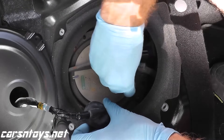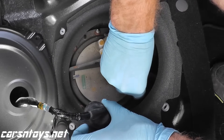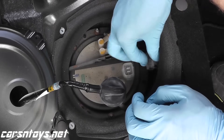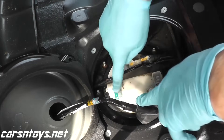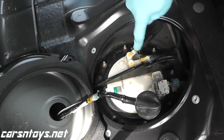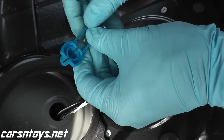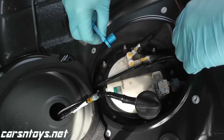Let's disconnect the fuel pump power adapter harness here — there's a tab right here, just press it down with your thumb and pull up. What I've done is remove the foam backing just so we have a better view, and we've cleaned up the top of the fuel pump assembly before pulling it out. Right here you have two fuel lines. To remove these you need a special tool — I'll include the part number in the description box below. It's around $20, or maybe a buddy has one lying around.